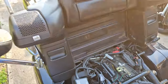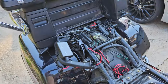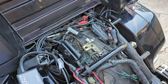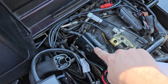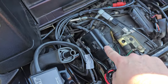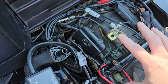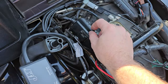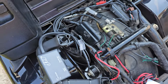So what you got to do - I've got the seat off here, here's the backrest of the passenger seat and the speakers. I read that you got to take the trunk off but you don't. You take the seat off and you're looking for the plug you got to deal with, which is the C33 plug right here. This is a 22-pin plug. When I took my seat off I realized that these plugs have a plastic protective case over them, so you see this case right here. You got to take this case off - it opens up, don't break these tabs, be careful.